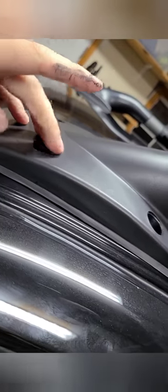So if you feel like you want to drill holes into your newer vehicle, I recommend using sealant and stainless steel hardware so it doesn't rust. I'm gonna get some plastic caps. I think they sell those at the local hardware store here. I'm gonna get some plastic caps to try to keep as much rain out as possible. But it shouldn't leak because it's got a gasket here, and then sealant on the bolt, washer and threads. The only way that it could leak is if this little rain catch here filled up with water and the water just kind of soaked its way through the bolt, which I'm sure eventually it probably could.